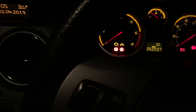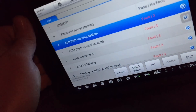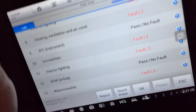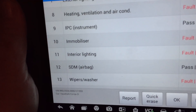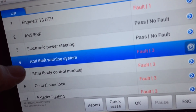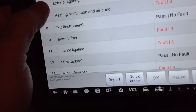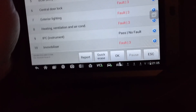I think it's a power issue. I went back to the scan tool and done a full scan, and you can see we've got fault codes now in quite a few of the modules. The one in the engine management is actually just for the EGR valve - I've created that. But we've got codes in the anti-theft, body control, central door locking, exterior lighting, heating and ventilation, immobilizer, and interior modules.